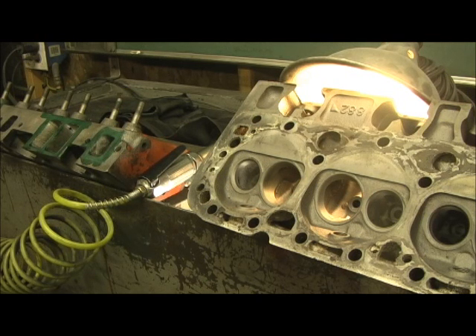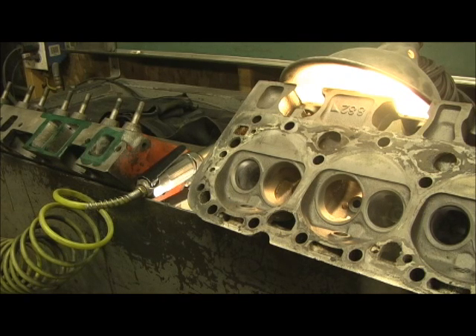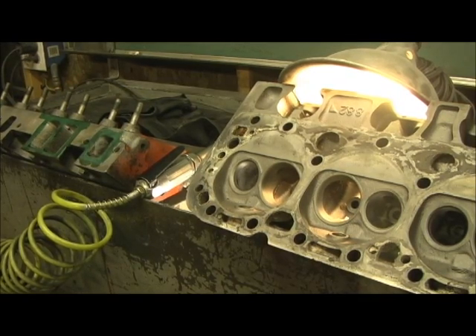You just got to have it if you're going to get serious. Anything over a stage 3 requires a sonic checker. Now, this is a stage 4, and I'm not using it on this head, but that's because I've probably done about 150 of them in the past 3 or 4 years — I've already made this sonic map 20 times. I know where I'm not going to get myself into trouble, but I just wanted to show you that's the method. That's what we use it for, and it matters. It's priceless. So let's go ahead and finish cutting Marty and Christy's head and get done with this.